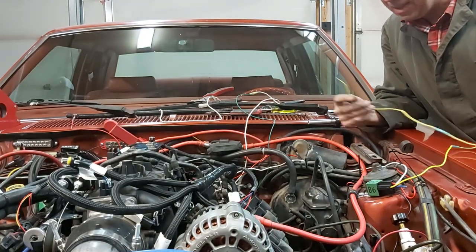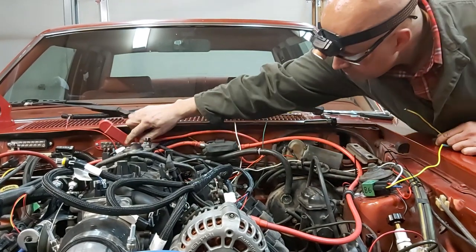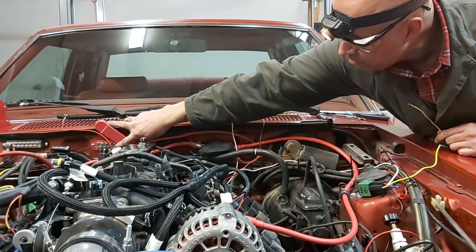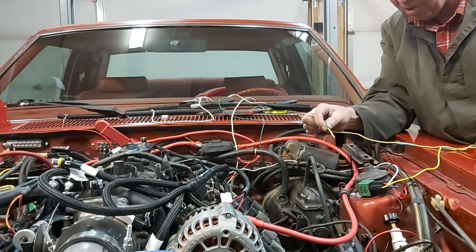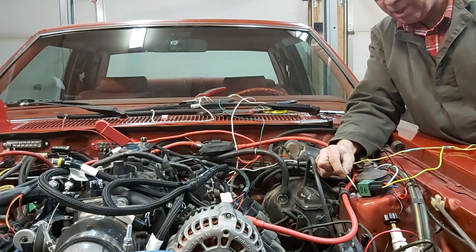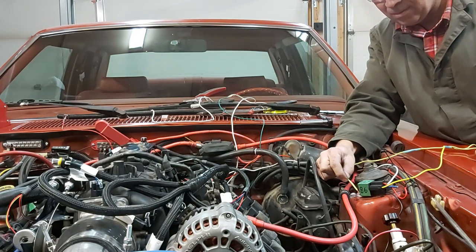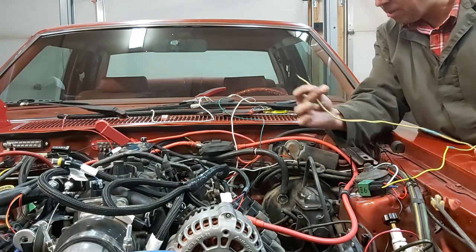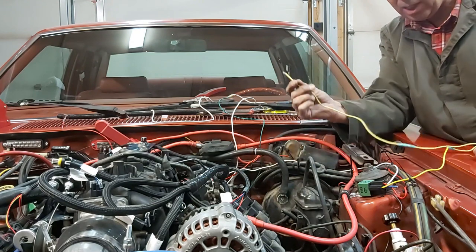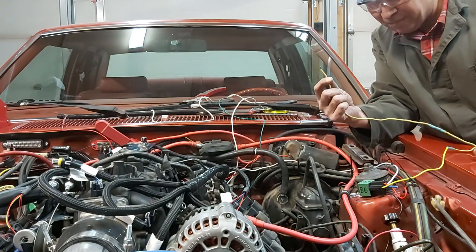Just to prove that this is now ground triggered — we have the white wire hooked up to our positive terminal block. So if I touch this to ground now with the relay, the fan should come on. I'm just going to touch this screw here. That's ground triggered now instead of being positive triggered as it was before. Now I'll just hook this wire up, bring it through the car, and hook it up to the gray and yellow wire from the ECM harness that powers our fan on the ground trigger.